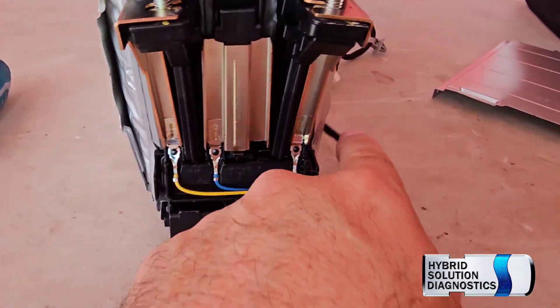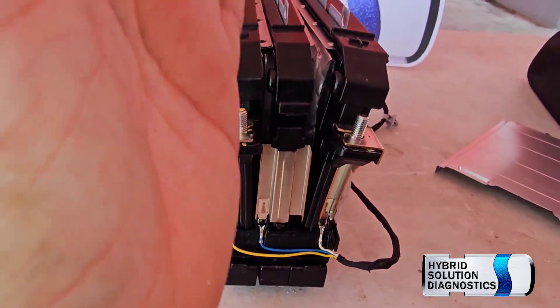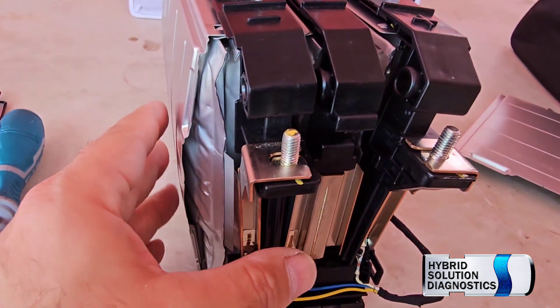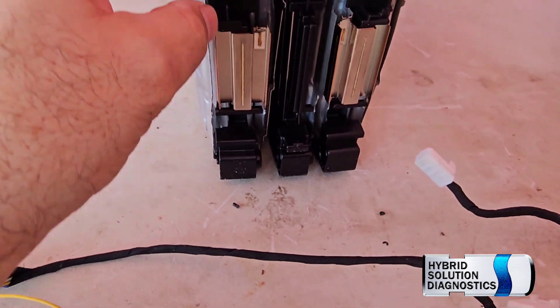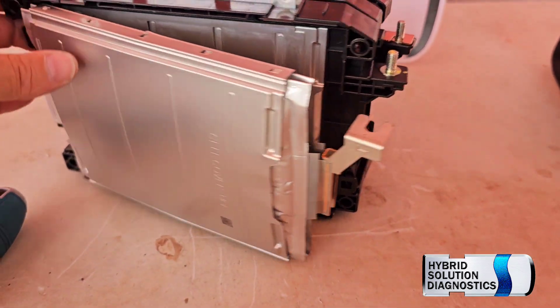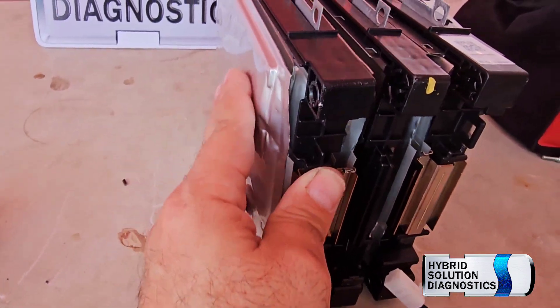What I'm going to do is just cut this cable because I'm trying to unplug them but I can't — as you can see, they're welded. So if we have one, two, three, four — let me see how many pairs. I think we have 10 cells over here. Let me make the count. I completely removed the cell voltage monitoring system, and finally as you can see, I can open now the battery cells. We have two, four, six, two, four, six over here, and finally two more — eight. So we have eight cells. It's eight cells connected in series-parallel — a pair of two connected in parallel and two pairs connected in series. That's how it works.